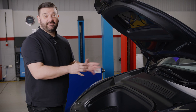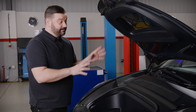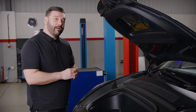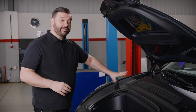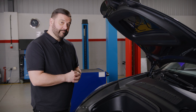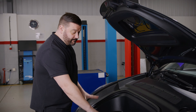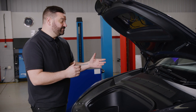Replacing the lithium-ion battery on these cars is really easy. The Model 3 is exceptionally easy because we can access it straight away under the scuttle panel. The Model Y has what's called bioweapon defense mode, consisting of a large HEPA filter assembly underneath the scuttle. So we're going to have to remove that as well to gain access to the battery on this particular Model Y. To do it: scuttle panel off first, then the main front tray, and then the HEPA filter assembly.